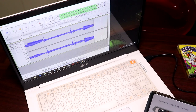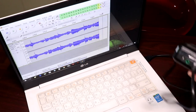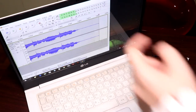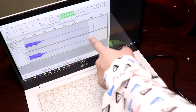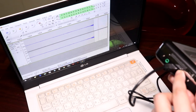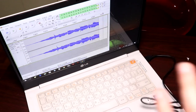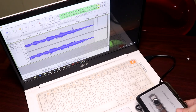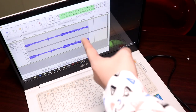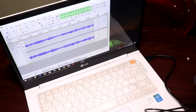I don't know if the crackling is from the device or if my cassette is just really too old. The volume that you output it at is how loud it's going to be recorded. So now I slid the volume down — as you can see there's barely anything coming out there. But the louder I slide it, it's getting louder again when you monitor it. So just keep that in mind — this is a purely analog solution, so it's not like you can lower the volume here and it's still going to be loud over there. What you hear here is what's coming into your computer.